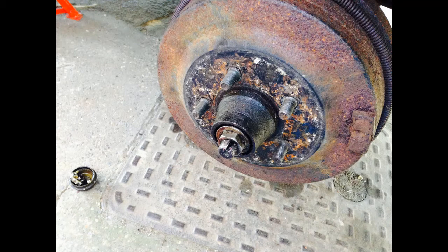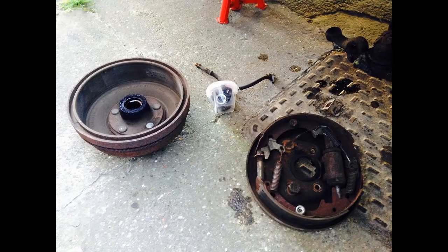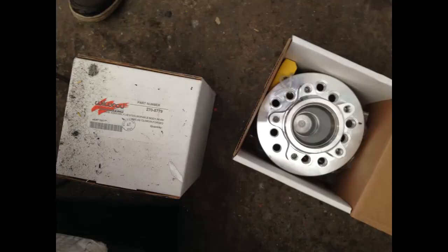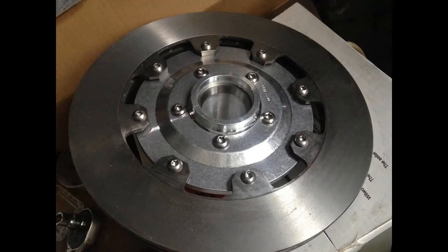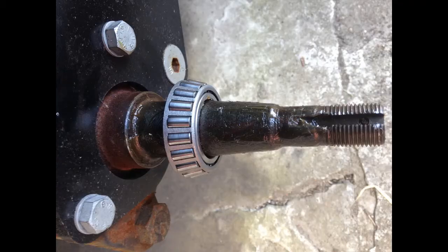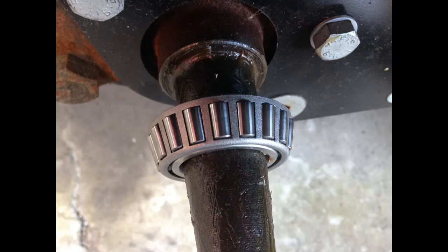When I took the drum off, I just took all the brakes off completely in one piece, still attached to the backing plate, because I wasn't going to be using those anymore. When you get your kit, you need to build the hub assembly and join it to the disc. All the bolts are supplied and the wheel bolts are supplied as well — you'll need to put it all together yourself. You can see the mounting bracket on the left-hand side, the black bits there — that's a new mounting bracket for the caliper. I went with new bearings as well, just put the hub on, put the nut on, and drove the bearings on that way.